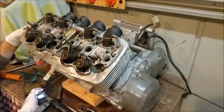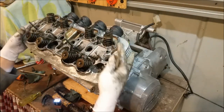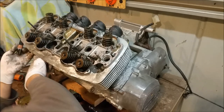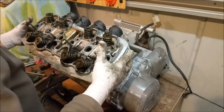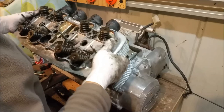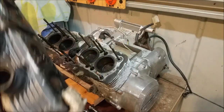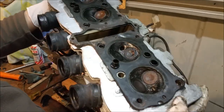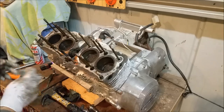Well, Honda certainly knows how to make sticky gaskets — this could be one of those asbestos ones too. It's just monumentally strong. You can sort of drive the bone in and knock it with a hammer. There's a bit over the side here. Come on — I think I got it. Wonderful. What's the story with these bloody valves? I'll take a better look in a minute. It's pretty messy in there.